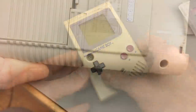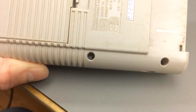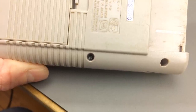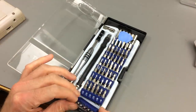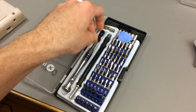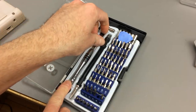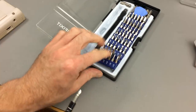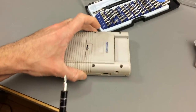These things have some weird tri-wing screws in there, so it's not that trivial to get in there without the proper tool. Luckily, there are some tri-wings in my iFixit bit set here. I highly recommend getting one of these or a similar set of strange bits.